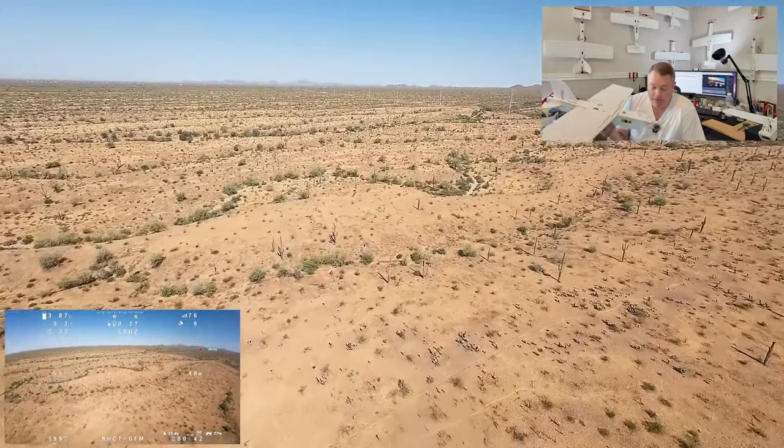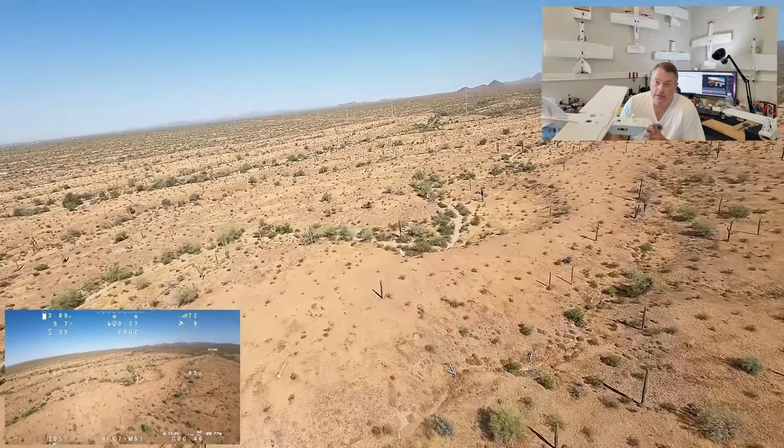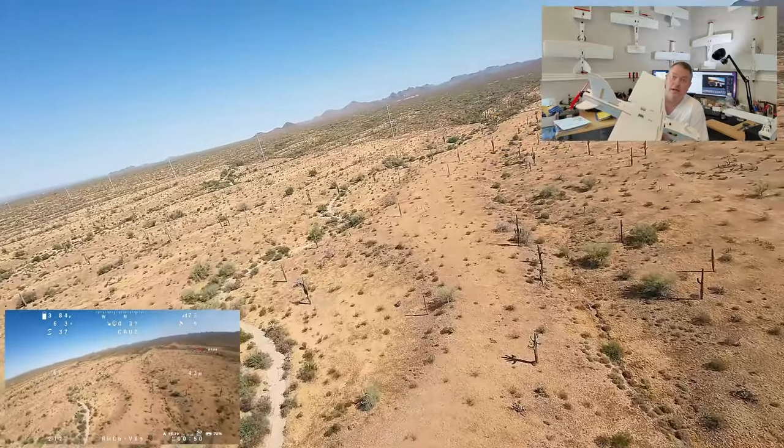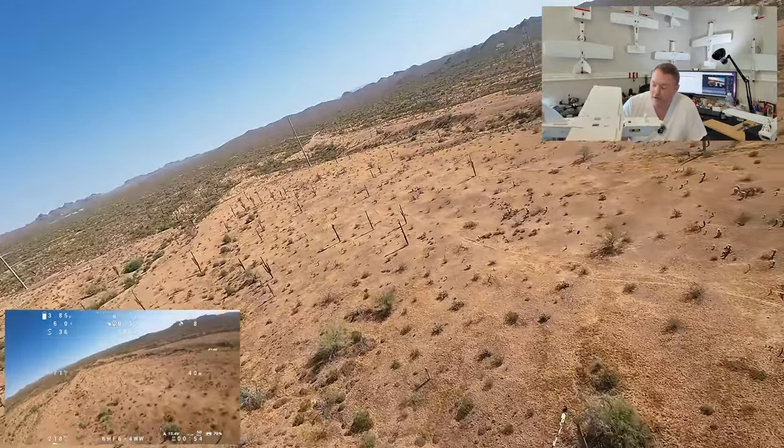The other upside of a plank, and particularly as it regards to FPV, is there's no propeller in view. The prop is a pusher, meaning it's at the back of the airplane and provides its thrust in order to get the airplane up and running.